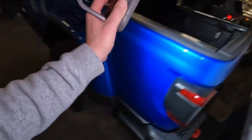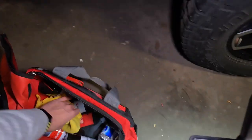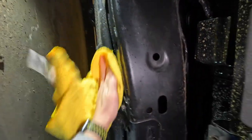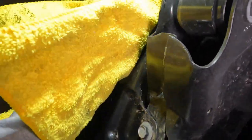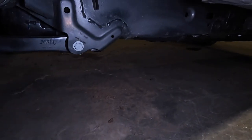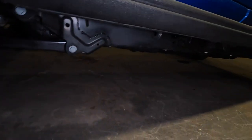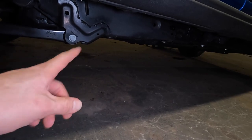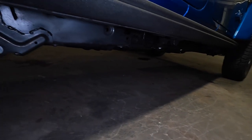I'll have a light with me so I can see exactly what's going on in case I have any spots I can't see. Let's wipe everything down - we don't have to go crazy, we just want to get all the dirt off so we're not sealing it in when we spray it. You can see how easily it all comes off with a quick wipe. Now we have everything cleaned and wiped off and we're ready to coat everything. You can pretty much coat everything under there - from your floors to your frame, control arms, axles, everything except your exhaust and your brakes.